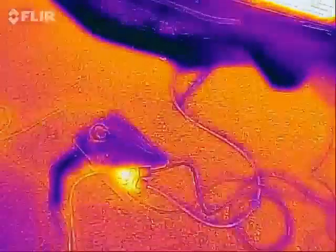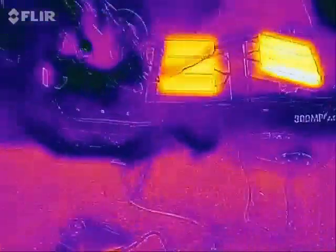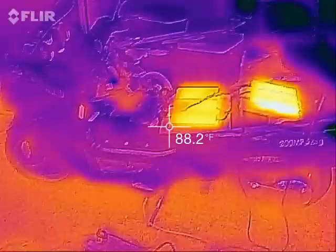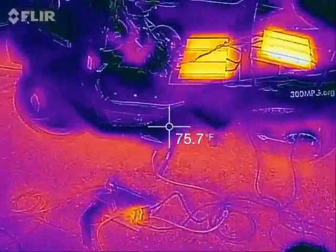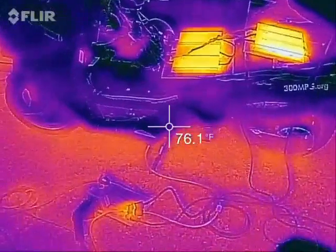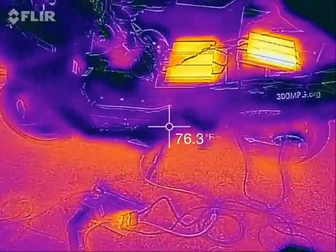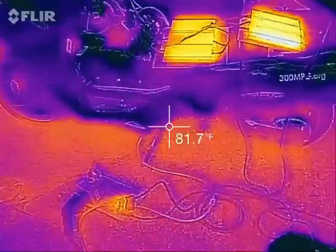Overall, I'm liking this. This means I can run all three chargers on a single J1772 connection. If I had to, I could run them on three separate 120-volt circuits, but that would be challenging because I would need three long extension cords, and it makes a lot more heat at 120 volts. So far it looks very promising.